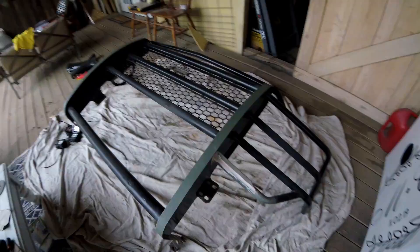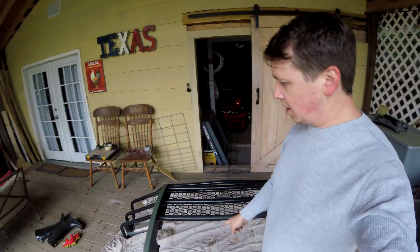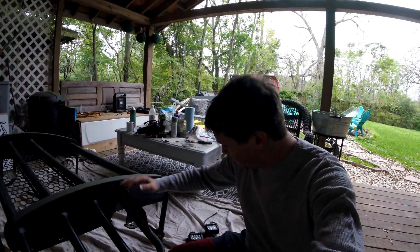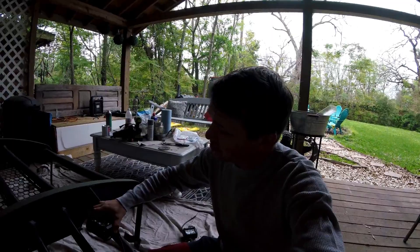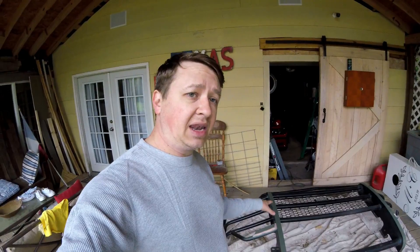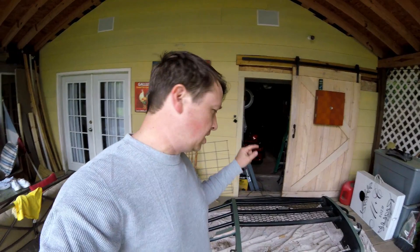The last thing you saw us do was mount up and start to prime our exposed areas. We have all our LED light mounting plates made. It's going to have one spotlight right there and one floodlight mounted over here — four lights total on the front, two on either side. We have to drill our holes for mounting so we get exactly where we want each light to sit and how we want it to project out, then we can sand the entire thing and start getting it prepped for paint.